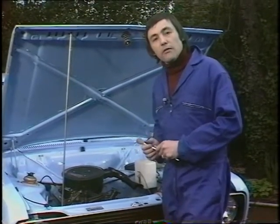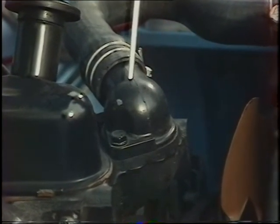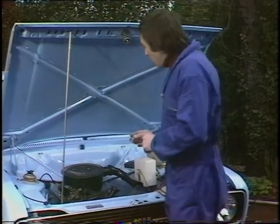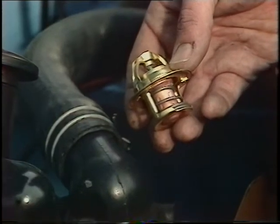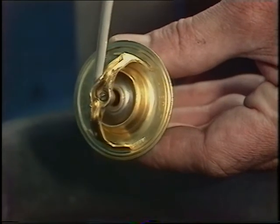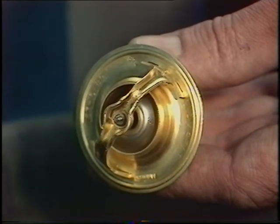The actual circulation of water inside the system could be impaired, which brings us on to the thermostat housing. To check the thermostat, remove the two studs and lift this off very carefully, because underneath there is a gasket that you'll want to keep and not damage. Inside you'll find a little device — this is the thermostat. Lift it out carefully and make a simple test: get a plastic washing-up bowl filled with near-boiling water and drop the thermostat into it. What you're looking for is that at that temperature the thermostat is actually opening properly. If it is, pop it back. If it isn't, change it — but don't just change it for any old thermostat. There's a correct one for your car.